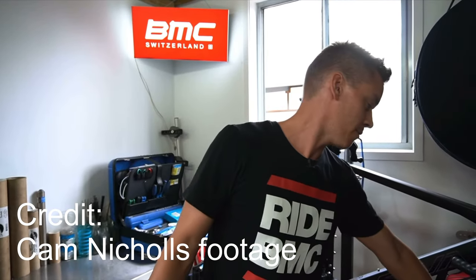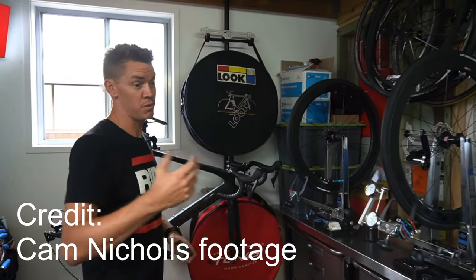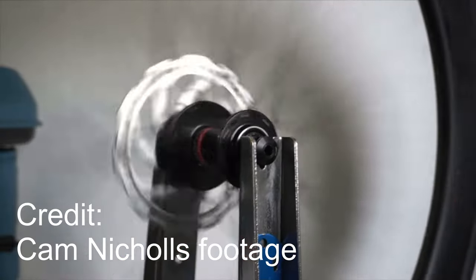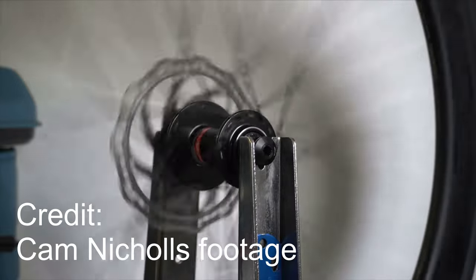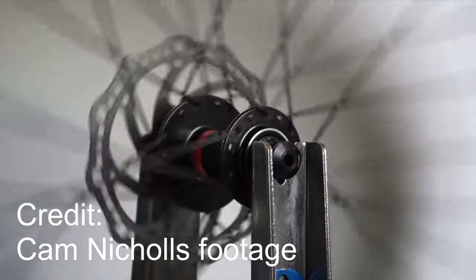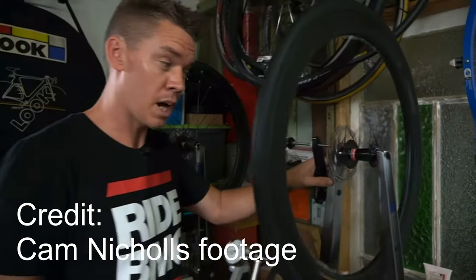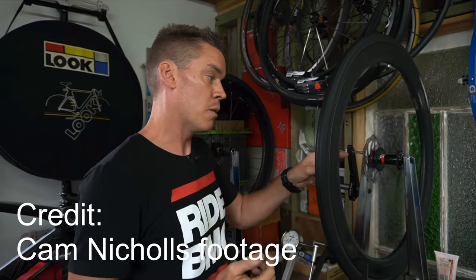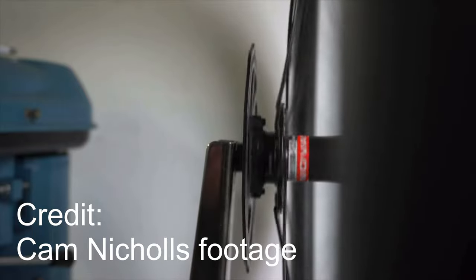The front brake — now that we have a good square face — notice straight away with the wheels that the hub bores have been basically drilled off-center. So the whole hub assembly oscillates; it goes up and down with movement. I've actually changed the rotor to a really basic steel rotor, but this one is nice and square — I've tested it on another wheel. But as you spin the assembly, there's a large amount of up and down movement in the flange, and that produces a serious wobble within the rotor. This is a Novatec hub, so it's obviously nothing to do with the Sava brand, but it's obviously what comes with the bicycle — you've got to take responsibility for that. For a normal person building the bike out of the box, could you stop it from rubbing? No, it's impossible.